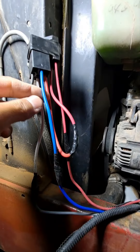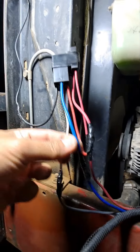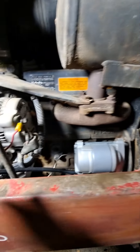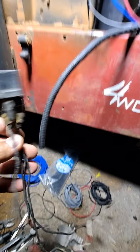Number 30 red going to positive with fuse. 86 going to ignition key switch — this blue. 85 body ground. And 87 going to starter solenoid. So here's the old one, the burn — starter relay and the wiring.